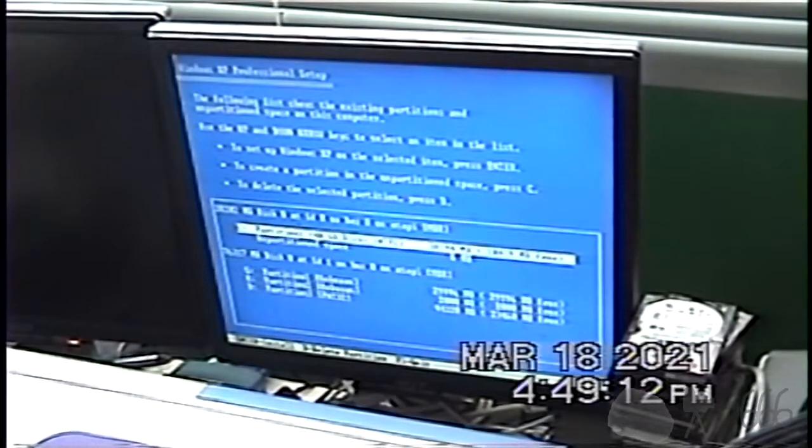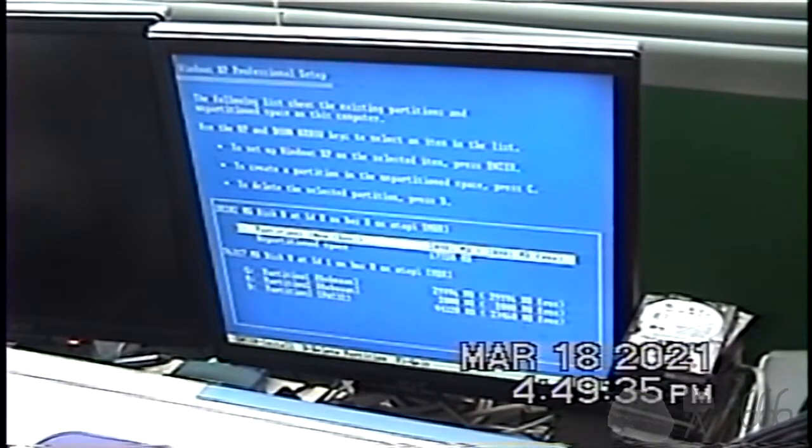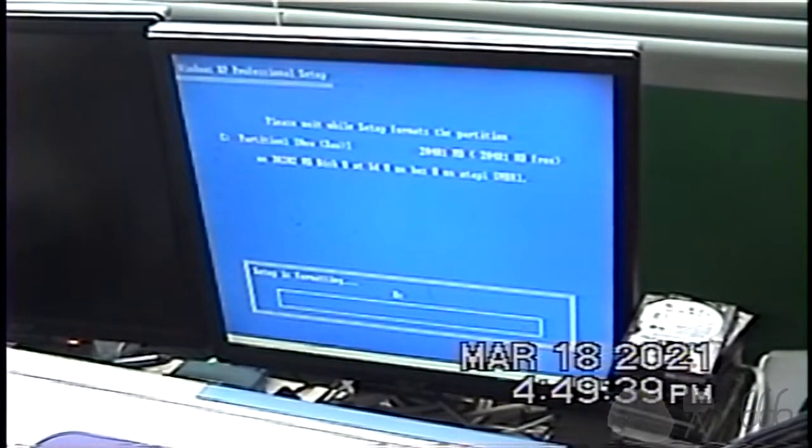So this will give me Windows XP Service Pack 3, which is good because I want Service Pack 3. Then I'll have to see about Linux — see how new I can get that to go. I want to delete that and create a partition. It's a 40GB drive, so I'll make it 20GB in size. I'm going to install to that: Quick Format NTFS. And from there I should begin the install process, which may take a little bit.